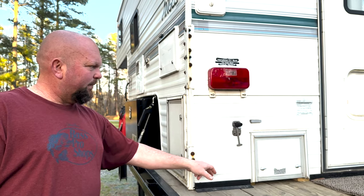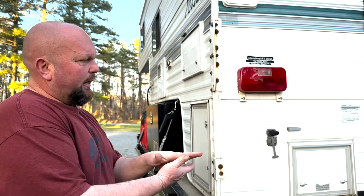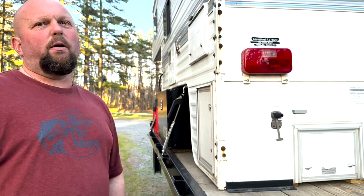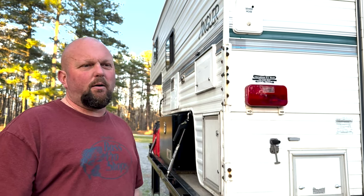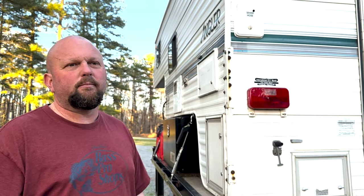And I also have angle under the trailer so it's sandwiched the boards together so it won't pull these bolts out. So it's there to stay now. And it can still move a little bit to let it flex separate from the trailer, but that way it don't tear it up. Right. Okay. That made it more solid. We pulled it, I don't know, 10, 15 miles like this and it didn't move now. So I feel good about it. It looks good moving with the trailer, so we should be good to go now.